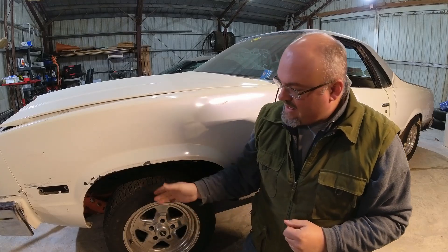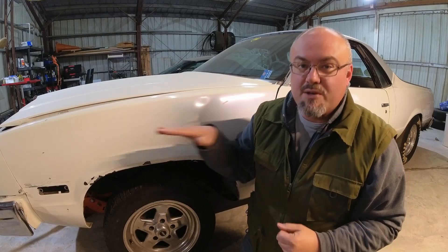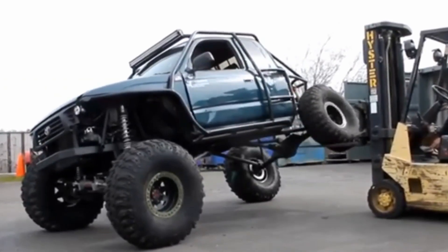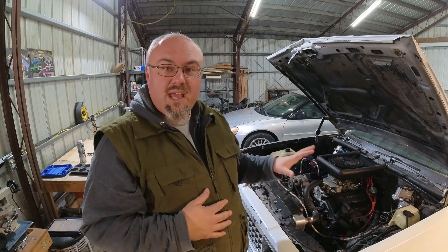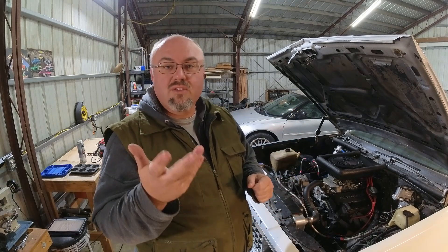This is at max travel right now, and from its ride height I pick up about four inches from normal ride height to top down. Now the next one, which I think is a lot more fun, is the freedom — the ability of your suspension to articulate. I'm not going to turn this into a rock crawler, but allowing the suspension to do its job and move freely. Things that go into that are the suspension bushings themselves. If you're running a car at the sportsman level and you're just getting started, sometimes if your car has those original crusty front bushings, replacing those can pick up a lot of consistency because your suspension is allowed to articulate smoothly through its entire range.